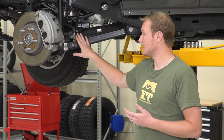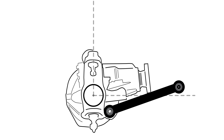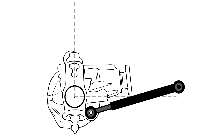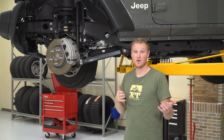You can get a lift kit that includes just lower control arms, just upper, or sometimes all eight. Sometimes they're fixed length, and sometimes they're adjustable. The reason for having control arms included in a lift kit is to re-center the axle forward and backward — put it back closer toward the center of the wheel well — and also roll the axle back so that your caster angle is back closer to factory, and your pinion angle is back closer to factory, so you don't end up with vibrations, premature driveline wear, or a Jeep that doesn't re-center the steering wheel.